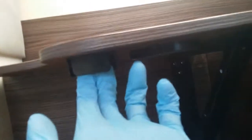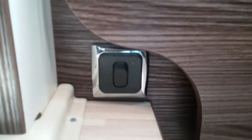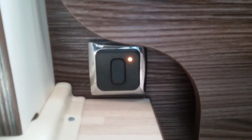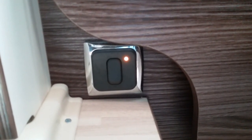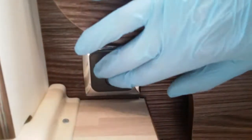To make the two travel seats, this section here just drops down — there are levers underneath and you just pull both of them at the same time to drop the section down, then just pop your cushion back on and you have your two travel seats. While this has dropped down we can also see a little switch here which is illuminated when on — this is the switch for the waste tank heater. If you are using the motorhome in cold climates, you can pop this on to avoid any frost damage to the waste tank. The fresh water tank does not have one as it is an internal tank.